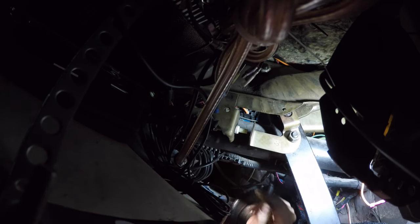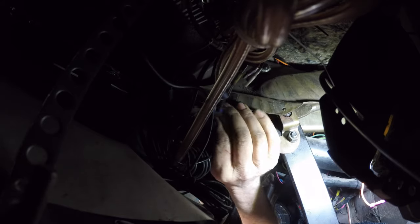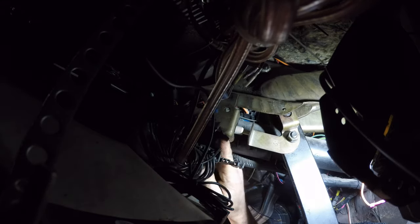You have to make sure that when the pedal is all the way back, this button is being pushed sufficiently in. Right now I can see when I'm doing this it barely pushes in at all, so it's too far back and I'm gonna want to bring it forward some. This particular year and make of truck is nice and easy because they have a holder where you can just push it in and out, but a lot of times you have to bolt them in and out. I've got a buddy back there double-checking. How we looking? Too late - okay, we'll move it back a little bit. How's that? Good, we're all set.